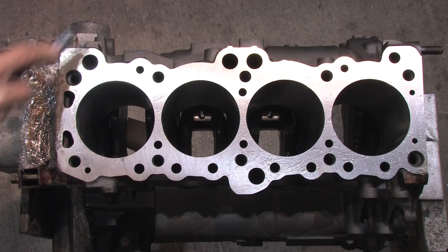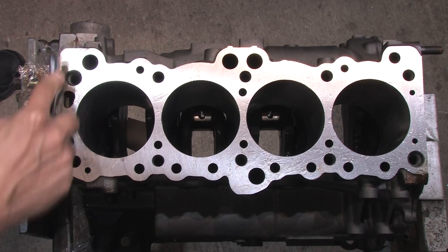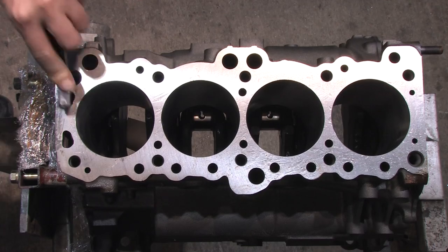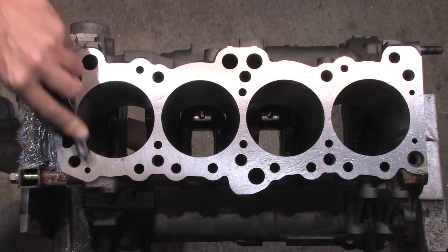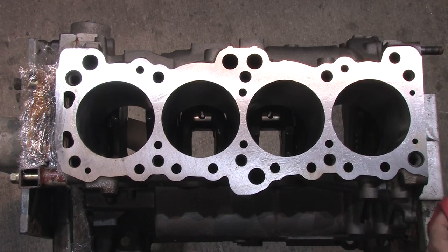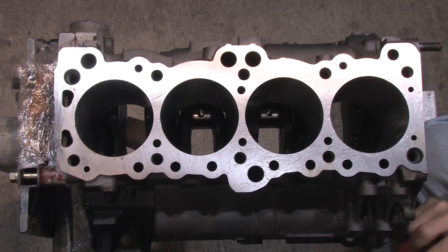but it sucks on milled surfaces because it leaves the top layer of a freshly decked block discolored by the physical change of rusting. I got here just in time to clean it up, but if it pitted and light sanding didn't completely remove it, I'd have to resurface it again. I'll still have plenty more opportunities to polish it up.